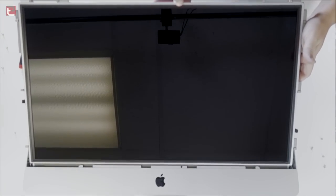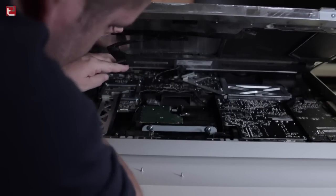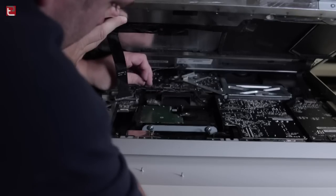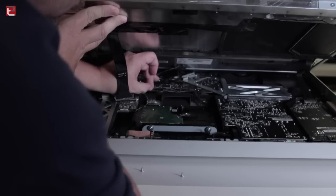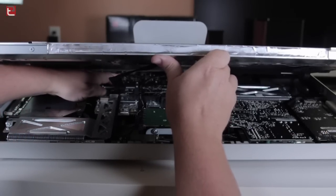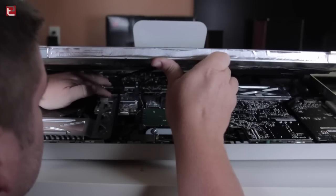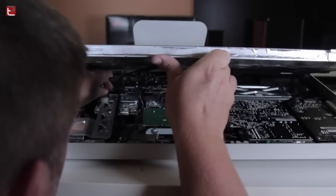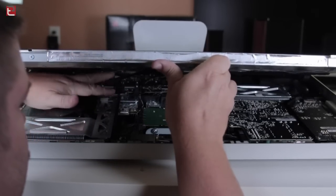The last thing to do is to carefully take your display panel and drop it back down in. What I did here was work from the bottom of the iMac to the top, for obvious reasons — there's only so much length to these wires, and you do have to plug them in a certain way. That first one I'm doing right there is a heat sink cable. There are many on there; this happens to be one of them for the display itself, and it actually just pushes in and snaps back into place. This larger ribbon cable is the DisplayPort, which snaps in and has two teeth on the side that actually clamp into place, so it'll give you a little click. I'm making sure that everything is connected, because if you turn this thing on after you've screwed everything back in and it doesn't work, you've got to take it all back apart again.